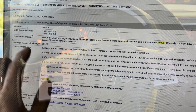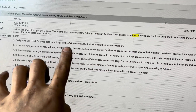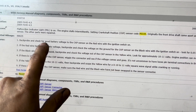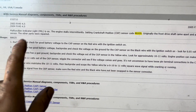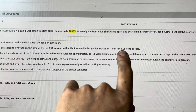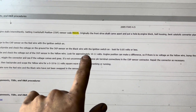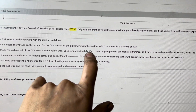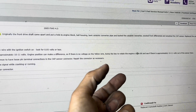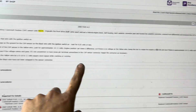I'm going to show you the problem. I've typed in the code and I'm going to follow the step procedure to diagnose it. It's a 3-wire connector. First thing I'm going to check — with the key on — is the red wire, looking for battery voltage. If that's good, go to the black wire and look for the ground, still with the key on, looking for 0.05 volt or less. Then go to the yellow wire and look for at least 10 to 11 volts. From there, if it's good, go inside the car and slightly rotate the key to turn the engine over a little bit to see if it maintains 10 to 11 volts.